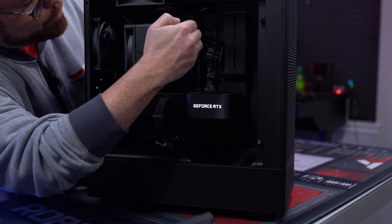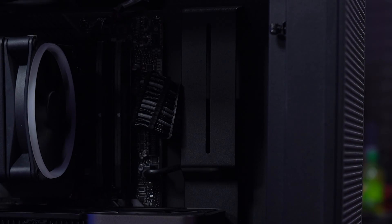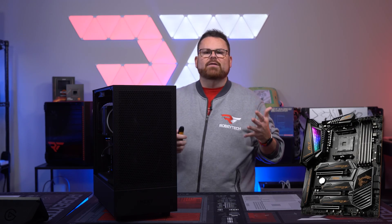Here's the caveat: this bar creates quite a bit of limitation. A standard board like the MSI Ace is about 277mm, so I don't recommend an EATX board inside this case even though it says EATX support. ATX and lower is going to be your safer bet.